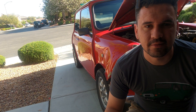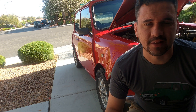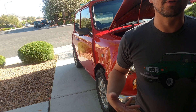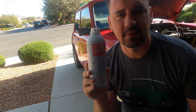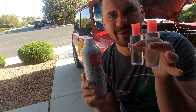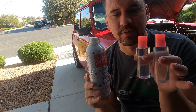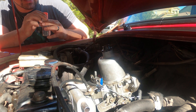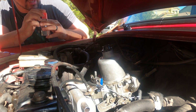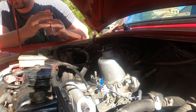I'm going to show you what I do to fix it using Seafoam. Also, if you have a second, like and subscribe, and check out the links for shirts. Specifically, we're using the Seafoam motor treatment — we're going to put half of it in the gas tank and the other half in these little containers so we can gently pour it into the carburetor while it's running. I suggest doing this outside because the car will smoke a lot, getting all that stuff out of the engine. I'll go ahead and start it now.